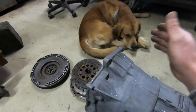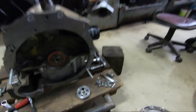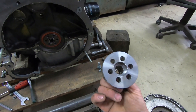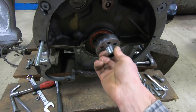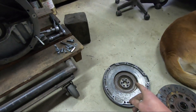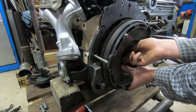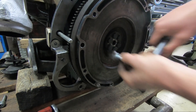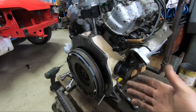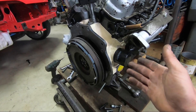In order to use all the bits from the BMW gearbox setup, we have to offset the flywheel a little to ensure proper clutch engagement. We're using this custom-made flywheel spacer with an integrated pilot bearing. This goes on like so, and now we can mount the flywheel. You could of course get a custom-made flywheel, but this solution works great — keeping it simple — and for these engines especially it shouldn't be a problem since they don't like to rev much past the 6k mark.